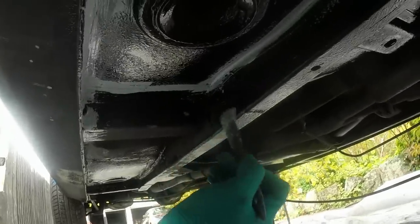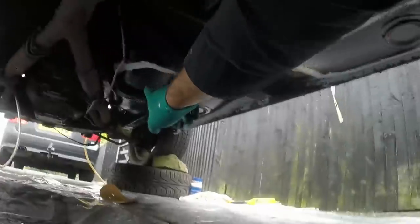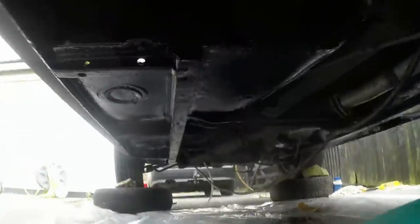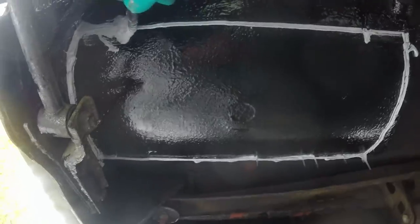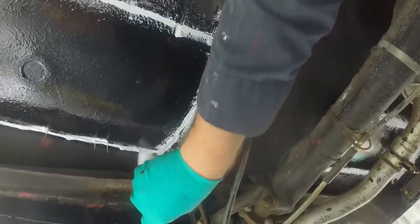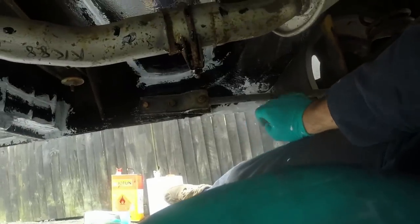You wouldn't know that all of that is new metal — pretty impressive. Look how nice and straight that chassis rail is. I'm not going to bother putting seam sealer around there because it's all protected anyway. Now I'm doing the other side but before I do, I'm just being smug — look how neat that is considering all that's new metal. This stuff strings up more than the brushable seam sealer, which is designed not to string up, but don't forget this is going to get another coat of stone chip stuff over the top.